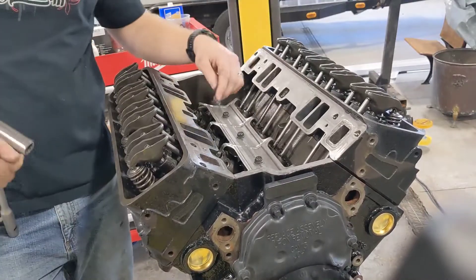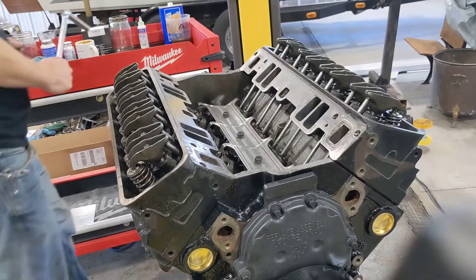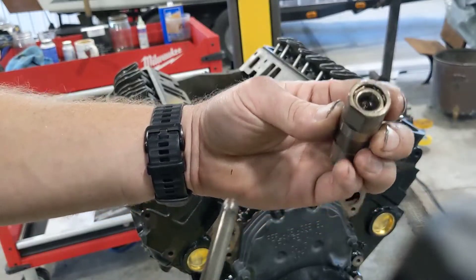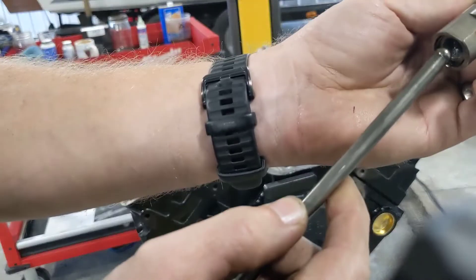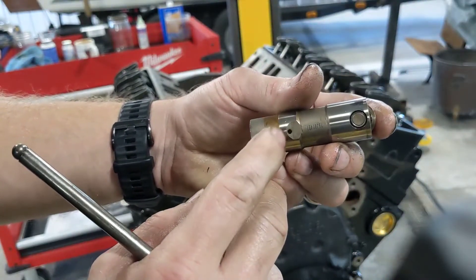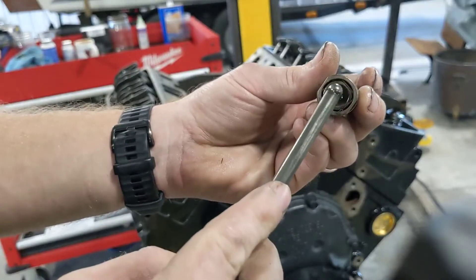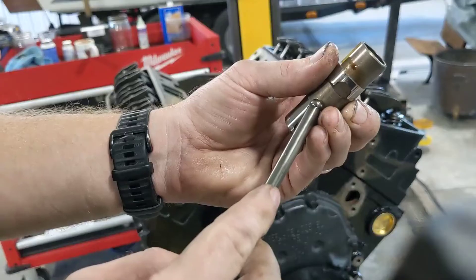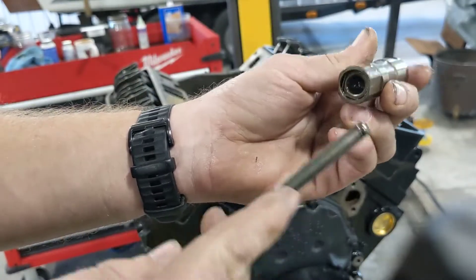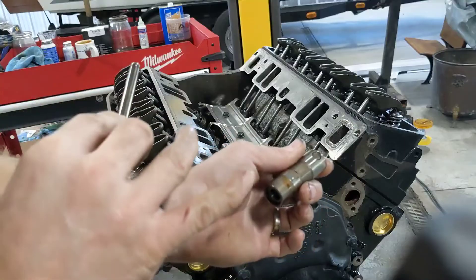What we've done is taken the slack out. So these hydraulic lifters — let me grab one and show you what they look like. This is a hydraulic lifter. You can see this cup — this is where the push rod that runs up to our valve goes. There's a spring in here and a hole that fills this up with oil from the block. When your oil pump's running, it's going to pump oil pressure in here and hydraulically pump up the middle of this. This piston — this cup piston on the top — is going to have hydraulic oil pressure behind it from your oil pump. Right now this lifter's not got any oil pressure on it, so there's a spring in here that pushes this piston up. All we're doing is slowly advancing that push rod until it touches that cup, and we don't want to go any farther than that at this point — we're going to preload them in a second.